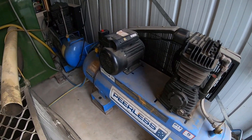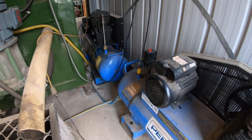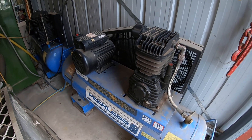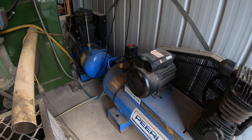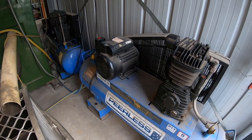Tucked in down there is my air supply. I've got two single-phase 17 CFM compressors that run in tandem, and these allow me to run my air at about 80 PSI consistently while I'm blasting.